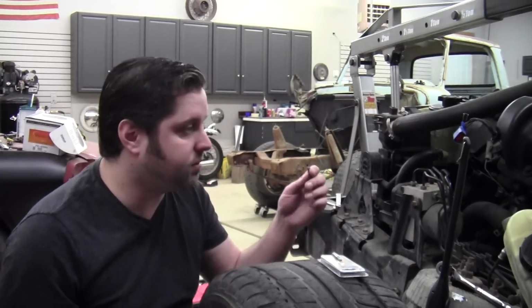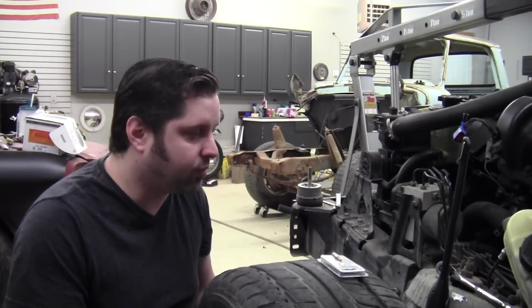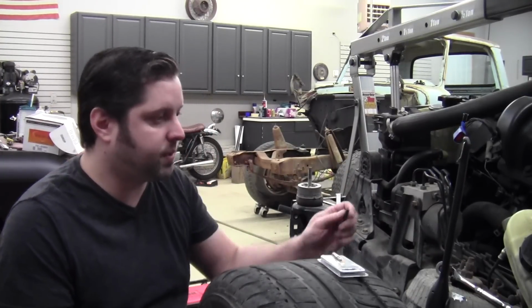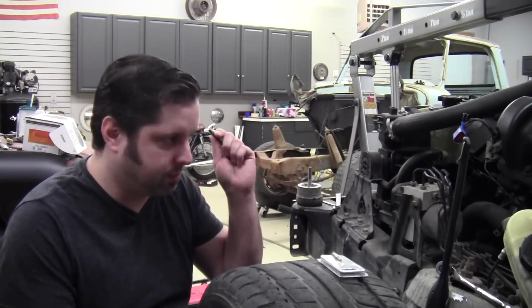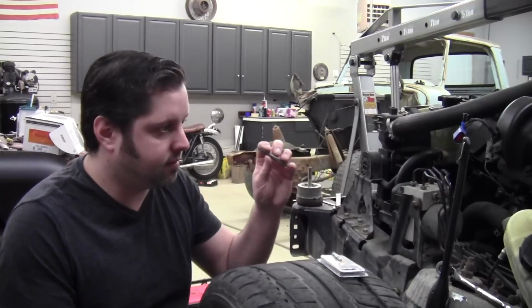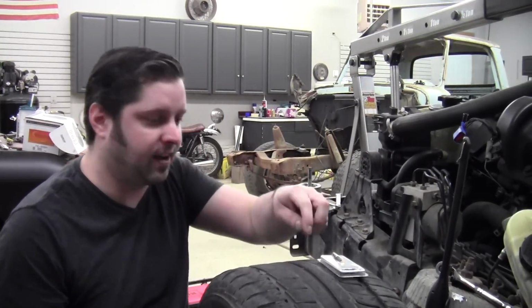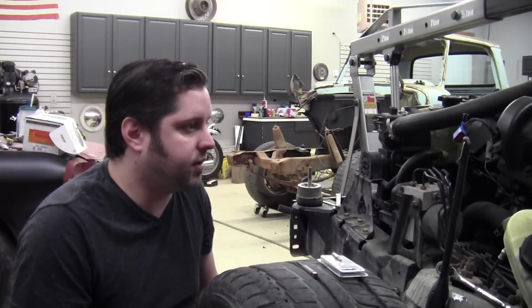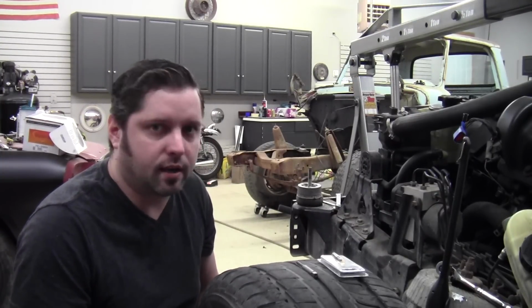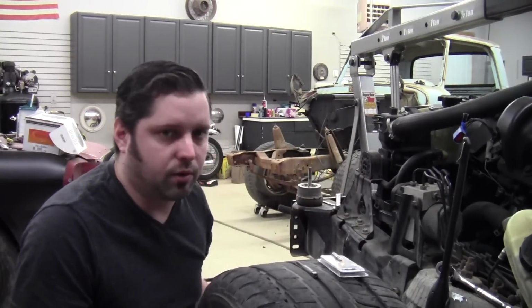And if you're asking why we are doing this on an F100 swap, why I'm showing you these manifold stud removal things, it's because a lot of these Crown Vics have exhaust leaks, and probably 90% of the time it's not the gasket, it's the stud has failed and it's opened up enough room for the exhaust to leak out. So chances are, if you buy an old Crown Vic, or even this is an 08, a Crown Vic that's got a lot of miles on it, it's probably got an exhaust leak up here. I've seen a lot of them that do, and you're probably gonna have to go through all this.